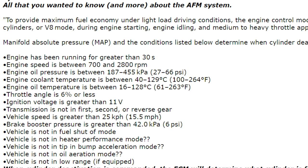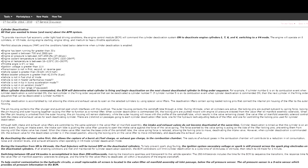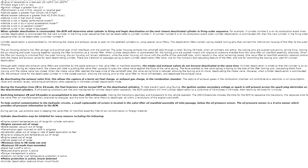Oil temperature, oil pressure, RPM, engine warmth, engine speed, vehicle speed — there's a long list of reasons why your Corvette goes into V4 mode and I don't like any of it. I don't understand why Chevrolet didn't make it so that only in eco mode it could go into V4 mode, so in tour, weather, sport, and track it would never happen. But if you have an automatic transmission and you go into manual mode, you can avoid the V4.